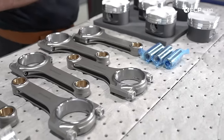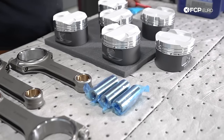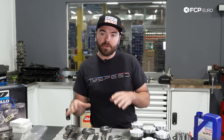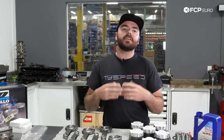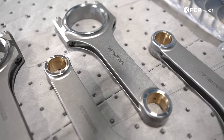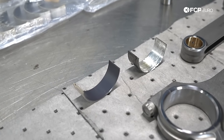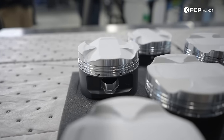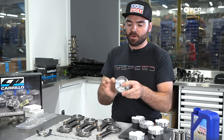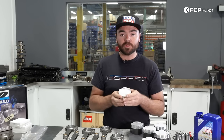What we have laid out here are our new billet rod and piston assemblies. We're going to be putting this together before the engine block comes back from the machine shop, which is where it's at right now, so that we can save some time on the assembly process. Here we have Carrillo H-beam billet rods, much stronger than factory. We're going to be using upgraded King coated engine bearings. We also have a failed engine bearing from the motor we disassembled and a brand new bearing for comparison. We're also going to be using CP pistons — these are coated pistons with a thermal dispersion coating on top and a skirt coating on the side. They're much stronger, their shape is different, and they have a slightly different compression ratio.